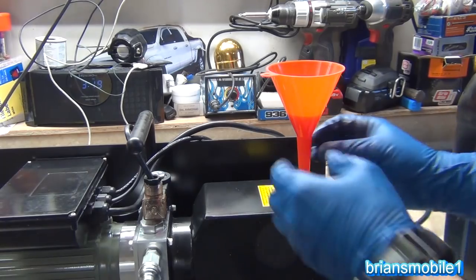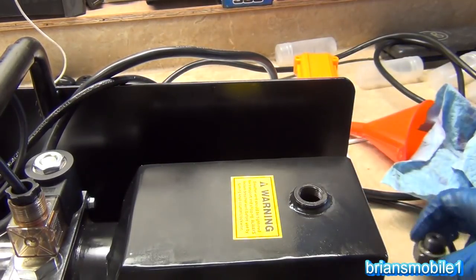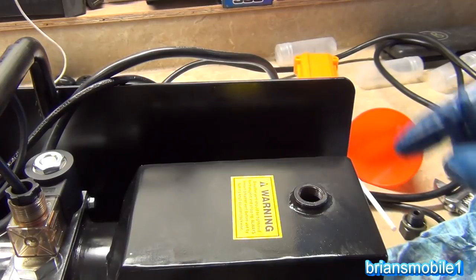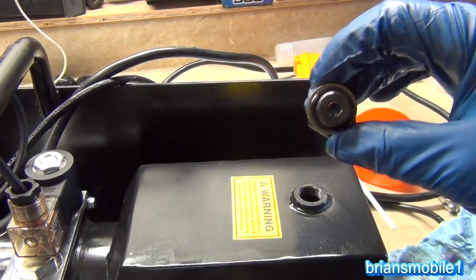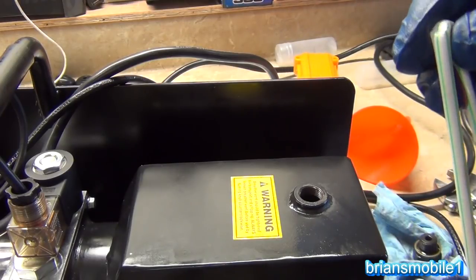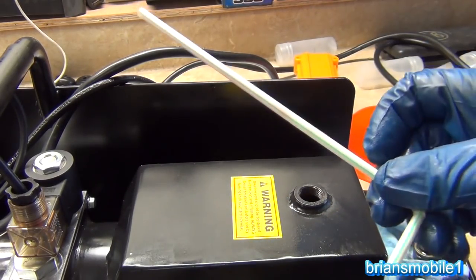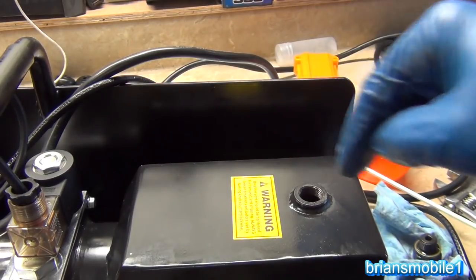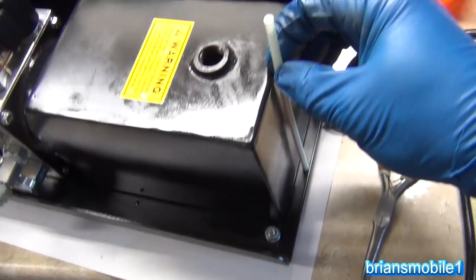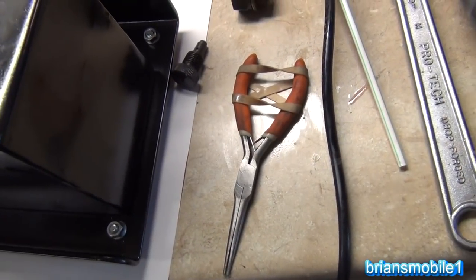Wow, that does not breathe or belch well. There's a fill port on top with a plug on top of that — make sure you pull out the bottom part when you go to fill it, and pour from a clean container through a clean funnel. If you don't, it takes forever because there's so much air pressure backed up in that tiny hole. What you can do is get a long bendy straw, have it down in there as a vent. I accidentally dropped a spray straw down inside — don't do that. I used a bent piece of wire to fish it out.